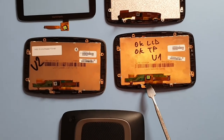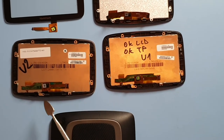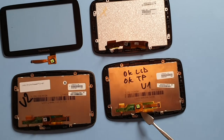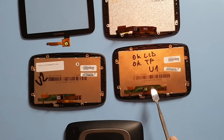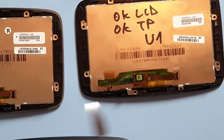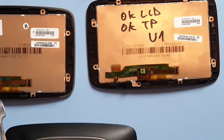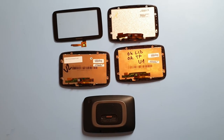Make sure you identify and differentiate between the two different touch panels. Although they look similar, as you see in the video, they are two different parts and even the connectors are different. Each touch panel has a different part number. You can locate these part numbers on the ribbon itself. So it's very important to identify which one you have. Thanks for watching this video, give us a thumbs up, and have a lovely day!